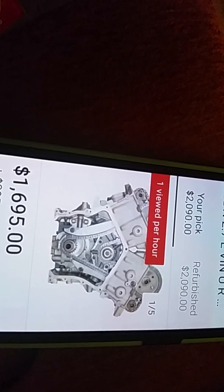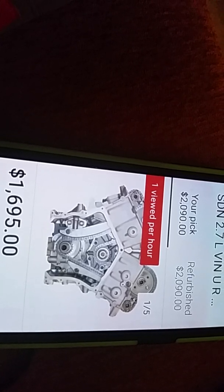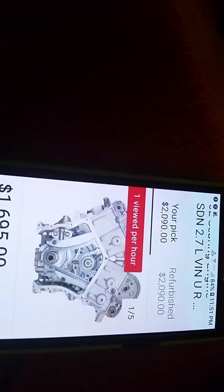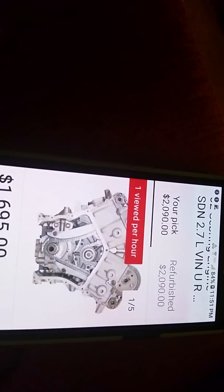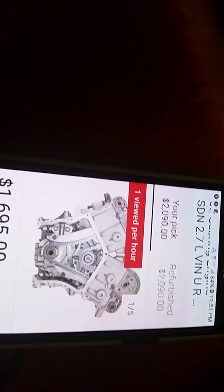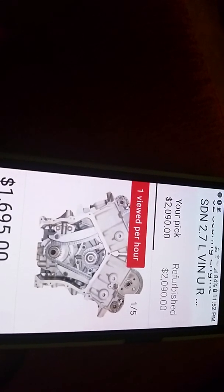So even Mercedes switched from 10W60 down to 0W40. Most European cars — at least 60% — use 0W40. Mobil 1 has a Euro oil, but I don't recommend it in Mopars because it's not MS6395 compliant. What I recommend is Pennzoil Ultra Platinum — don't be fooled by just regular Pennzoil. The Ultra Platinum is a little more expensive but worth it.